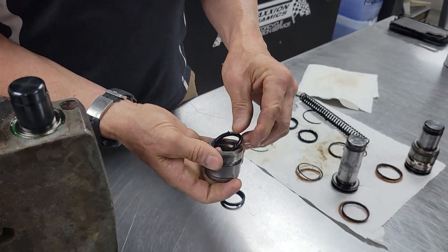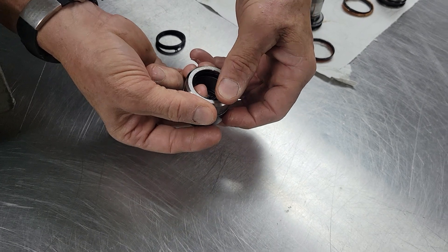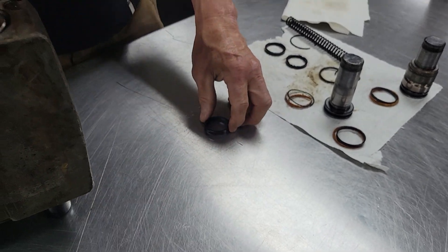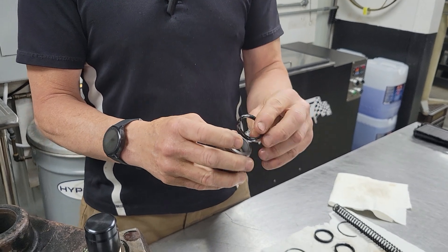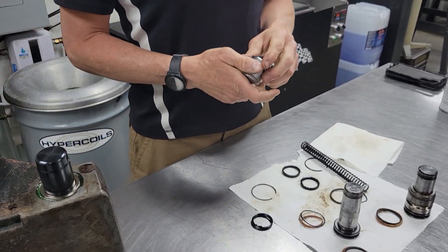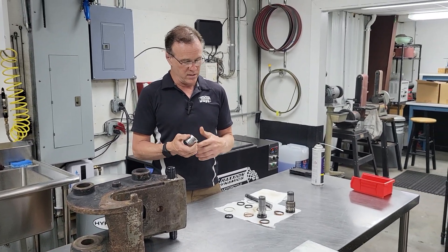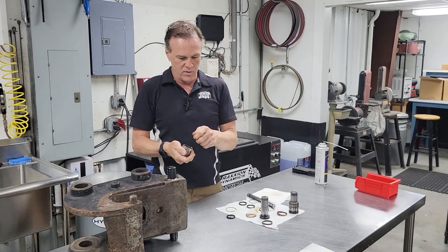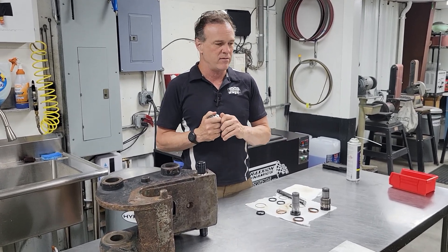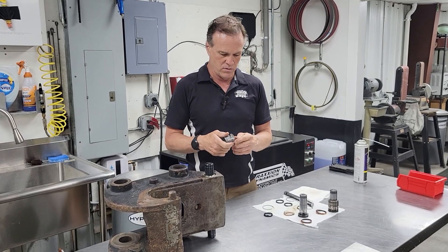These are a monster to try and put in or get out. You can get them started easy, but a teardrop forms that's very difficult to get in. This old one kind of went right in — the hard one is the one in the middle of the bore, much more challenging. I saw a video where a guy suggested to buy four of each — two per side — and have a couple of spares in case you tear one up. If you've gotten this far and you can't get the seal in properly, and you have to use a pick or a screwdriver to take it out — don't try and reuse that. Throw it away. Don't pick something out and reuse it; you're wasting your time.